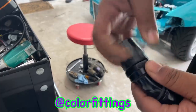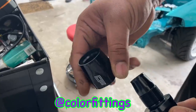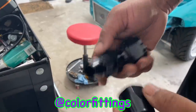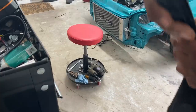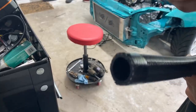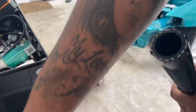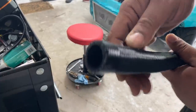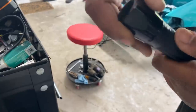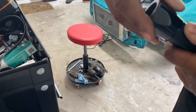What I do with these fittings: you unscrew the bottom piece — I guess we would call it a male and a female. See how I cut it? It's pretty straight. I find it easier to put a little bit of oil inside of it and on the fitting — makes it go in a lot easier. The tape is there to keep the braid from flaring up.